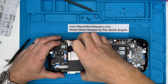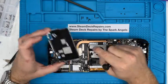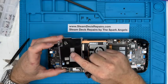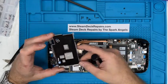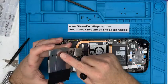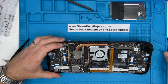This is mainly a static and heat dissipation plate. You've got the thermals all under there, and these thermal pads, sticky pads that touch the top of the chips, as you can see, actually take the heat out of that and transfer it, which is why there's no black sticker on any of them. They transfer it straight to this metal plate, which acts like a radiator and radiates the heat out. So we're going to put that there with the screws, keeping them all with each other.